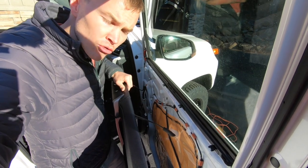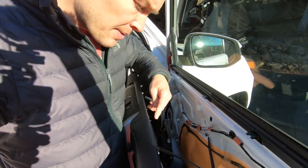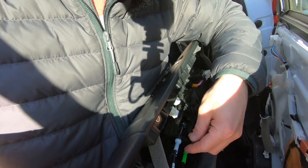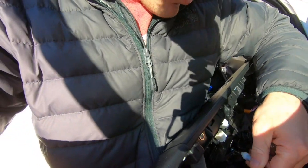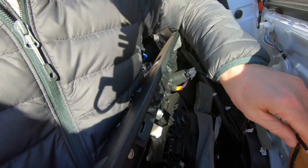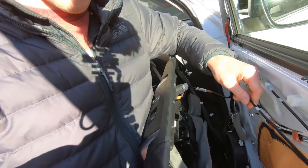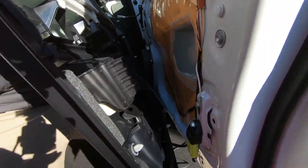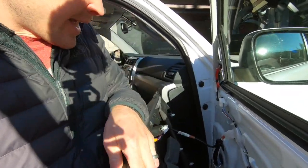So you can see we've got the door panel removed here, but we've got a couple connections that need to be disconnected. First up, we've got the connection here for the door handle and door lock — white on the top, green on the bottom. Want to remember that when you put it back together. These guys just pull out. You pull that out and then you'll see this little ball in there just comes loose. Down below here we've got just a little electrical connection that needs to pry off — you'll just disconnect that.